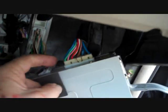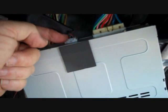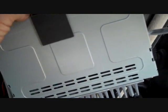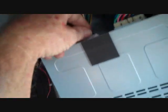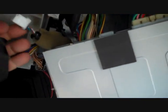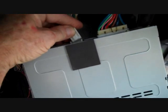We have two connectors going into the front of this: the main input power along with output to the speakers, and the input connector with the communication between the radio and this amplifier control box. We started checking the wires when we realized — in case you ever have this problem of the dash being taken apart and put back together with no audio — the same connector up here for the AC controls, next to the fan motor, is a small white connector. It's the same connector coming out of the amplifier that transmits audio and communicates. What we found is they had been swapped, causing no audio. The radio had audio when it came into the shop, and no audio when they were done putting the dash back together.